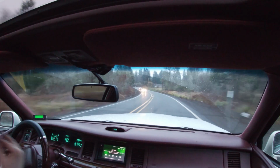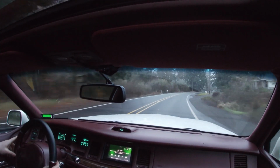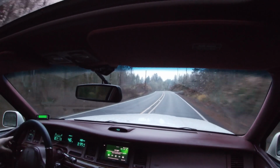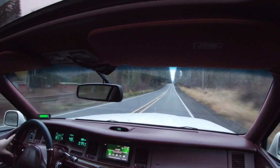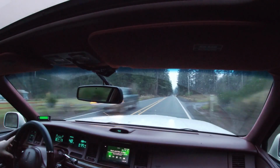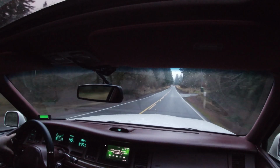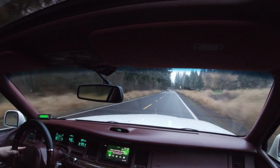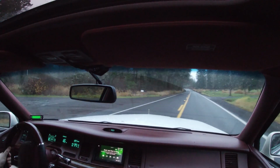I think my two biggest annoyances right now are the alternator noise, and then I have that rear end shaky shake. This alternator is a new alternator, but it's had this pulsating thing going on since I put it in this car. When I first did the sound system stuff, I really didn't have that shaky, jostling thing going on. But now it's getting worse and worse, and sometimes you just barely get into the throttle and it goes into the torque converter, locks up, and once it locks up, then the whole car just starts doing that. It only does it at low speed. It doesn't do it at high speed.